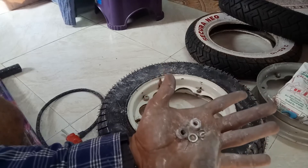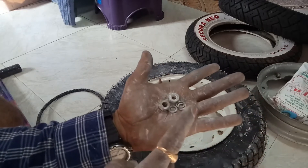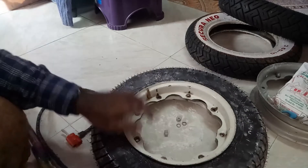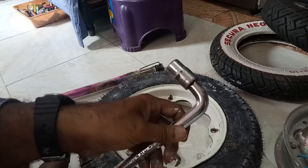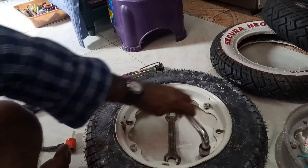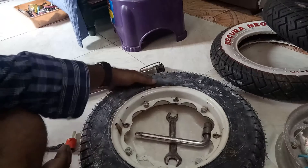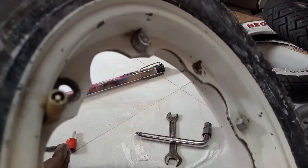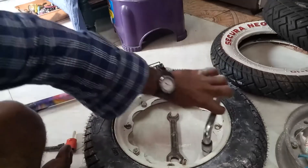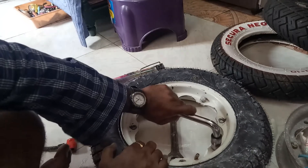These washers avoid self-unlocking of the nuts. Please remember — this is the safety point which is very very important. Use a size 14 bit, place it and tighten the nuts. Tighten the opposite one first, then the others. There should be no gap between the two rims. Don't over-tighten — that's all.